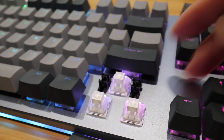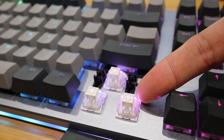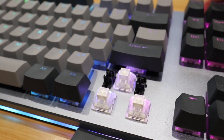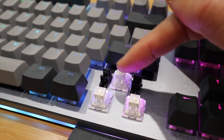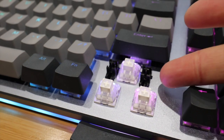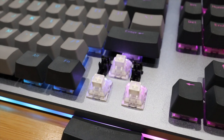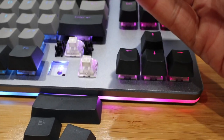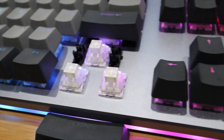The Drop Control comes with a selection of key switches — you can order Kailh or Cherry MX, and there's a whole selection to choose from. The price depends on the switches you choose. My unit is equipped with Kailh Box White switches, a clicky switch that sounds really nice and feels quite good — tactile. But this keyboard is hot-swappable, so I can remove a switch and add a different one. I can try a linear switch, a tactile switch, or stick with the clicky. Just plug in a new switch and you have a whole new typing feel.